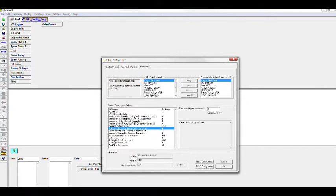So the way to do that is in that page there, on the dash info page, in the custom programming options, there's going to be a line that says start recording when channel exceeds value. So you're going to click on that. It looks like I have it highlighted in blue on there for you guys. When you do that, just to the right, it's going to say it again, start recording when value exceeds. What you're going to do is type in whatever that value may be. So if it's 2000, 1000, 6400 like I do, whatever you decide, you just type it in with the keypad, so 6400. And then after you do that, again, make sure that you send the configuration over to the data logger. Power on, serial cable hooked up, send the information over to it.